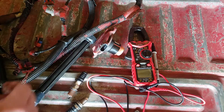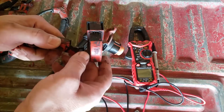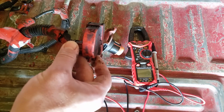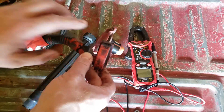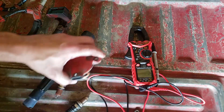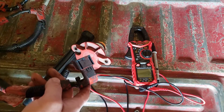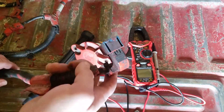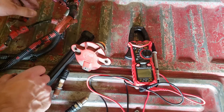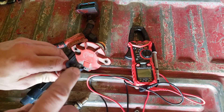From your ICM — your ignition control module, which sits on the side of the engine — say as you're looking at the engine, the ECM is here and the ICM is up from it over there. It looks just like an ECM except it has this harness going out of it; the other side where the input is goes to the ECM. First thing you need to check whenever you have a problem with these: make sure all your connections are dry in the ICM as well as to this.